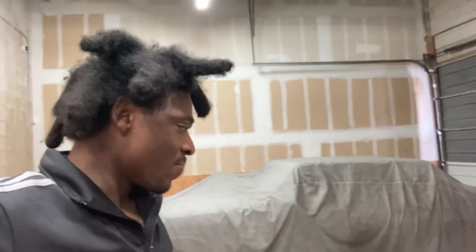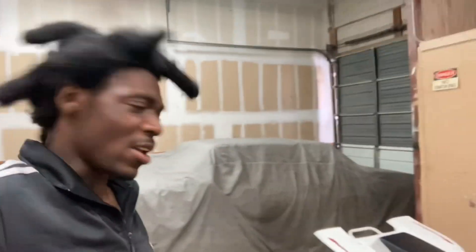Well, it's not too loose, but it looks like this is the wrong sprocket or something he has on his chain. Y'all see how the sprocket looks — it is loose. Something is not right back there on the real sprocket, because the chain is skipping on the teeth of the sprocket. Yeah, the chain is skipping, y'all.